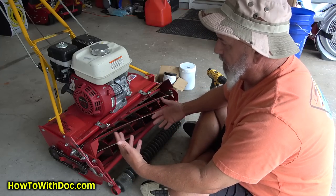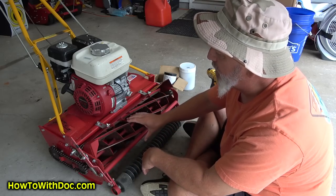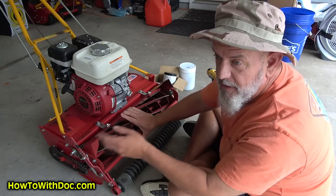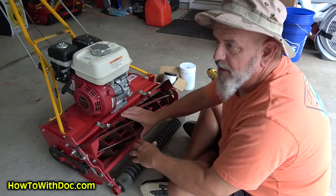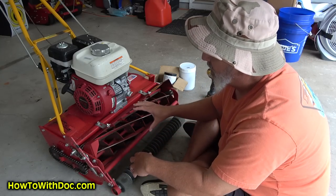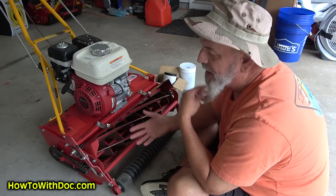The brand that you choose is going to have to do with price, but I also think being able to work on the unit hands-on is really important. Can you replace the bed knife yourself? Can you replace a ball bearing system yourself? That stuff is really important to me. I don't want to have to send this off somewhere halfway across the country to get it worked on. I want to be able to work on it myself. I'm not a mechanic, so if I get a really complex piece of equipment I'm taking it into the shop. That's why I like this unit — I've gotten to the point where I could basically strip this whole thing down and put it back together. It's not that complex once you start working with it.